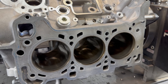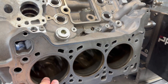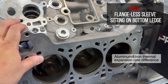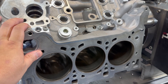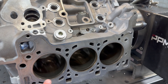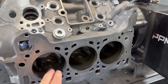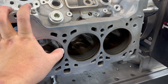That probably doesn't matter, because the nature of these flange-less sleeves in an aluminum block — especially during high horsepower applications — is they tend to sink a little bit because of the different thermal expansion rate of the liner and the block. The flush surface is at the ledge at the bottom, so the deck surface of the original liner tends to move up and down a little bit, and given time they produce this result.